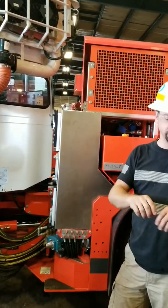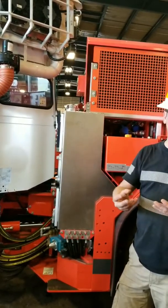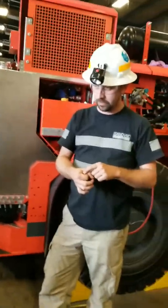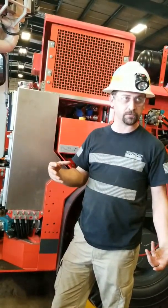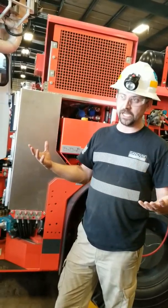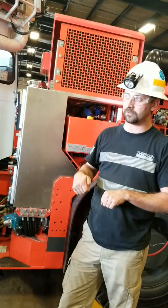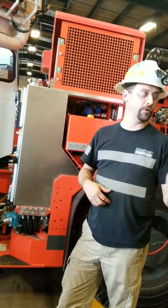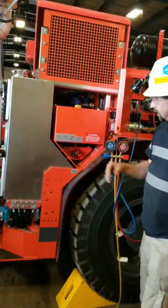You never have to deal with a plug like that — you can't get it apart. You think it's an expansion valve, you put one in, break that hose, and it's full of a bunch of white debris. I'm telling you, the dryer got so full of moisture. If you catch it early enough, you take an air hose and blow all that out. But most of the time you're not getting it out — you're going to replace the hose. You have to replace the system.